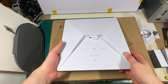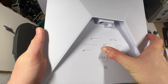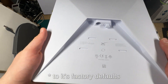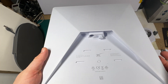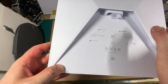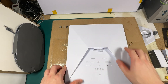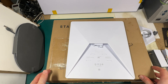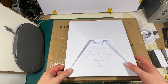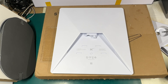There is also a hidden reset button here. You just need to press it until you hear a click. This button resets the router to factory defaults. So if you forgot your Wi-Fi password, just press this button for 3 seconds. In this corner you will see a blinking blue LED — when it starts blinking, release the button, and your built-in router will be reset to its factory defaults. You will then see an open Starlink network — just connect and configure your Starlink router as with any other Starlink terminal.